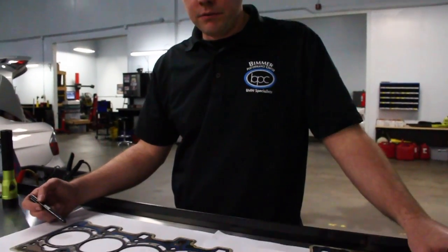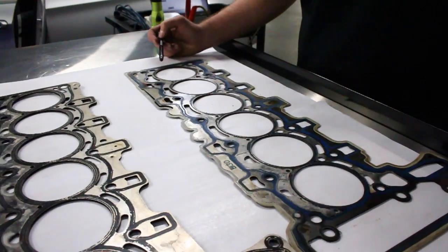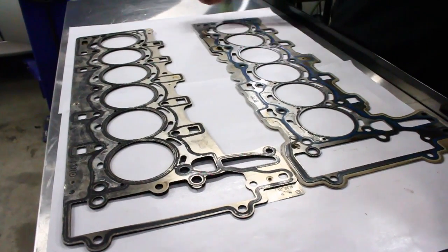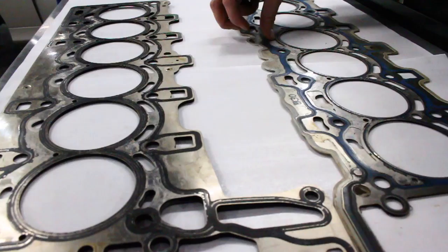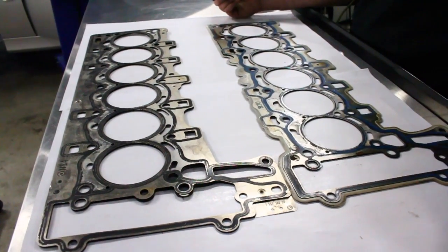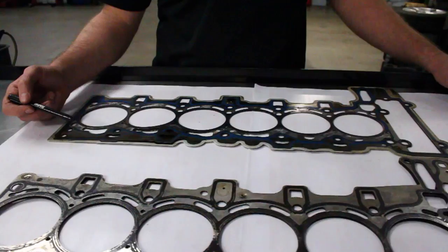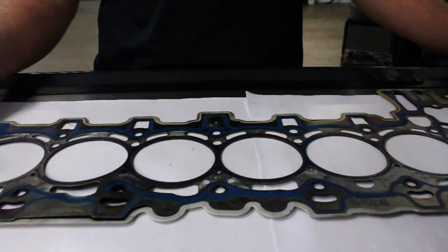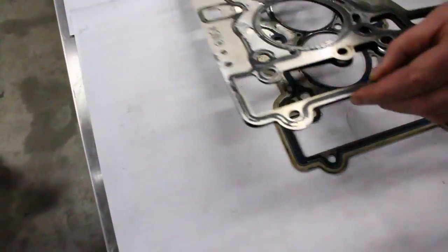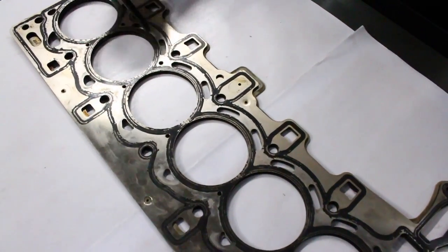Next, we'll talk about the differences between the head gaskets — N52 versus N54. Obviously the bore diameter is different between the two gaskets. The openings for the coolant passages are a lot larger on the N52 versus the N54. The other major difference is a piece of rubber around the perimeter of the N52 head gasket, which is not present on the N54 — likely to prevent water ingress and dissimilar metal corrosion between the steel gasket and the magnesium block. That's why all these motors have aluminum bolts. If you lay the two gaskets over each other, all the bolt holes and passageways line up, with just varying differences in size.